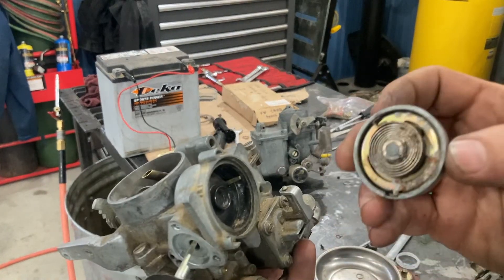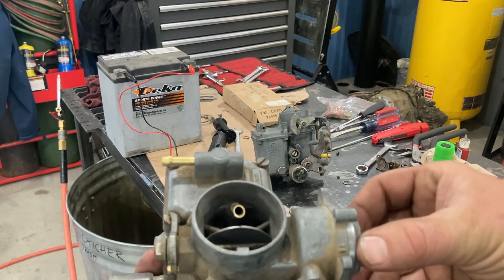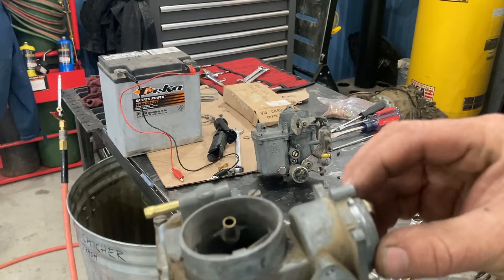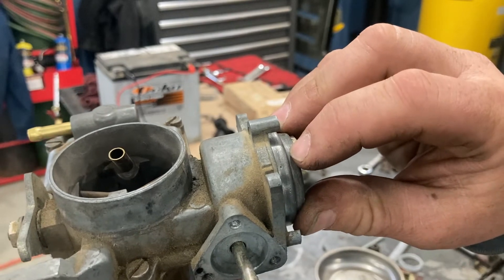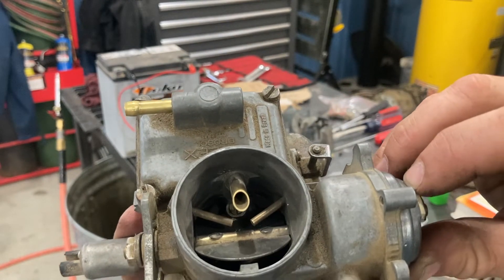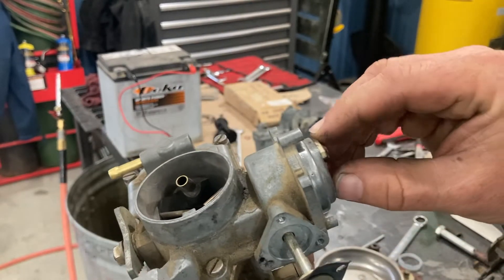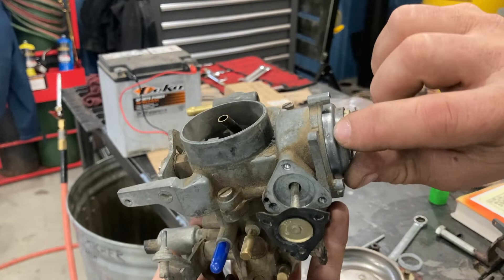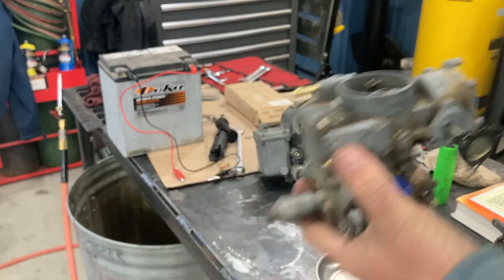I'm going to put this on now and rotate it until I start to see the butterfly move. Volkswagen gave you a little dot on there — a reference mark — that is supposed to line up in the middle section of these witness marks here to set the choke, and it leaves it open just a little bit. If you want, you can adjust it a little bit tighter to close the choke more. You would then use the screws and the spacer to tighten that down into place. The Bentley manual tells you to take the witness mark on the choke piece and line it up in the center position on these lines. That's how you set the choke.